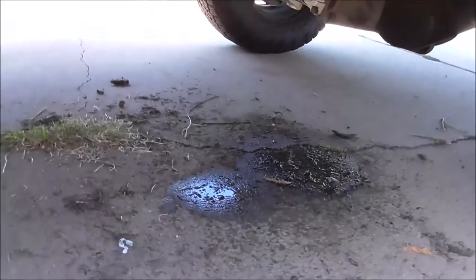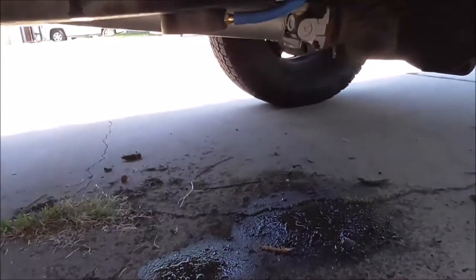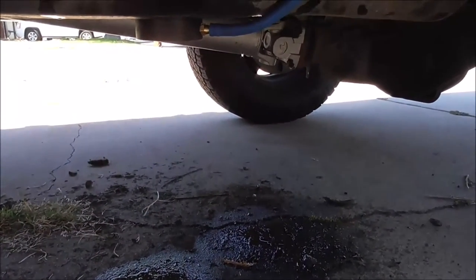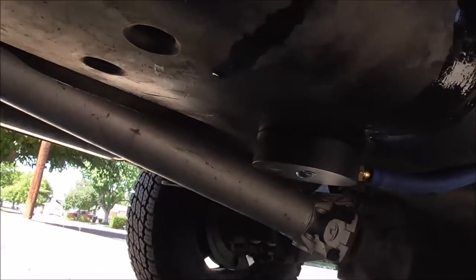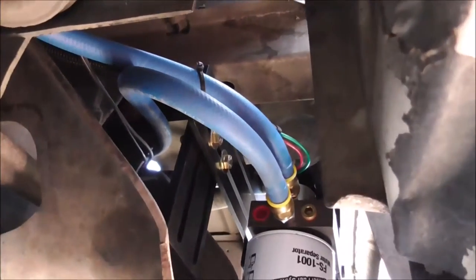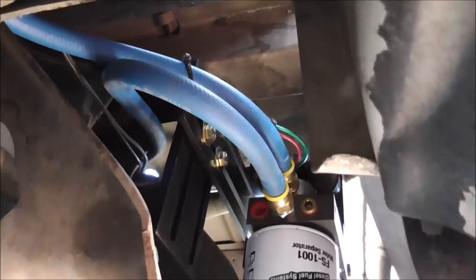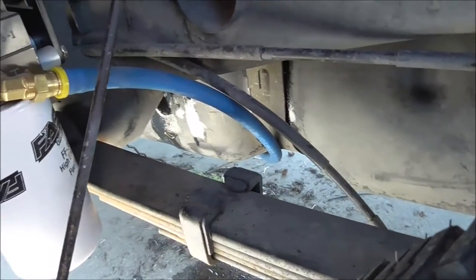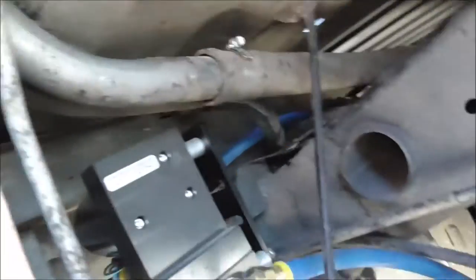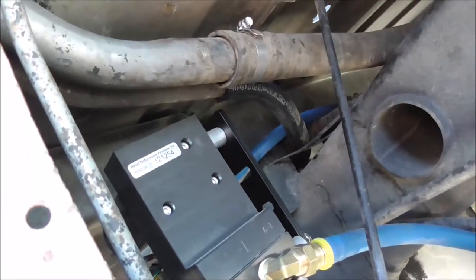It's leaking here only because I disconnected the line on the front — it's leaking through the old inlet pipe. But the sump is not leaking at all. Pump is in, all plumbed. That dripping is just the excess from the old fuel line up top draining off. There's the feed line going down to the sump. Everything up here is taken care of — new breather line installed.